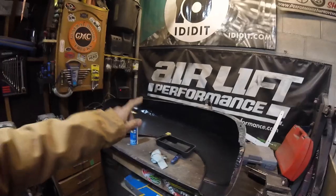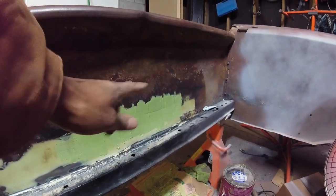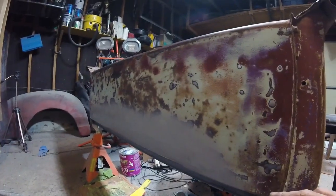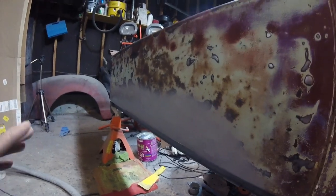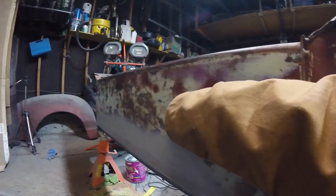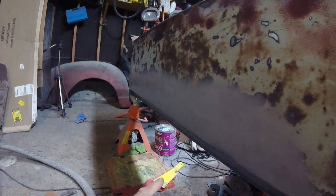We've laid some paint and put some filler down. I put some filler down and still have to go over it with another coat — there's still a depression I'm trying to get out. On the other side, I've hit it all with primer and it's drying. There's a lot of damage in this back panel. Once it's dry, I'm going to block sand it again and then go straight into patina work. I'm not too worried about it looking damaged — these high spots are all dents, and that's kind of the way this is going to be. I just didn't want this back panel completely rotted through, so I fixed that.